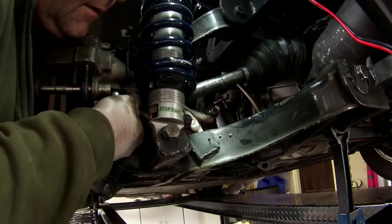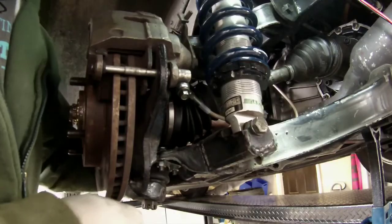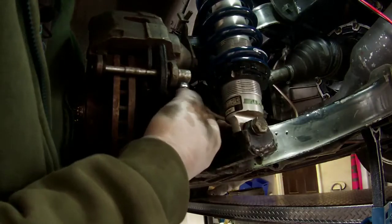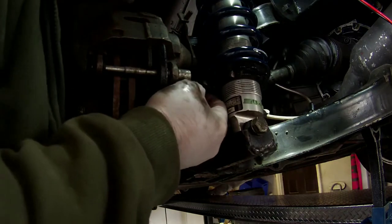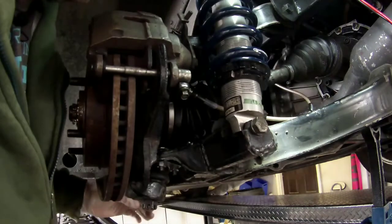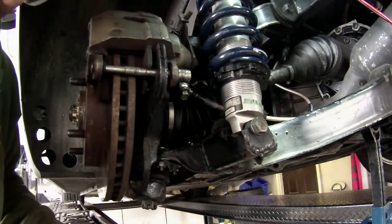And we did the stainless steel brake lines. We were just replacing the rubber ones that were on there. And I was hoping to get a little more pedal feel out of the car and a little more braking. And I don't know if it really made a big difference, nothing really super noticeable if there was a difference. But anyways, we did all four.